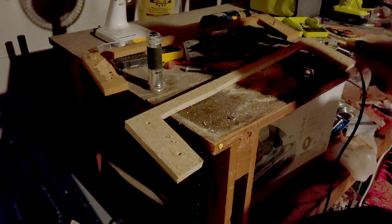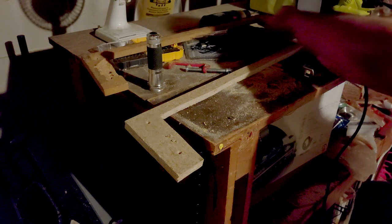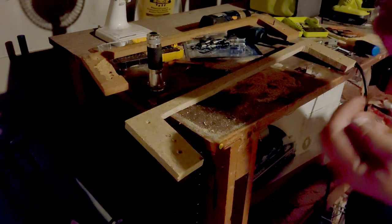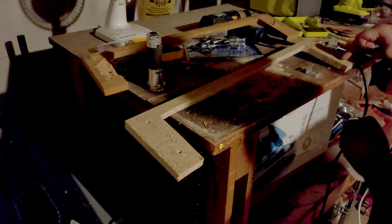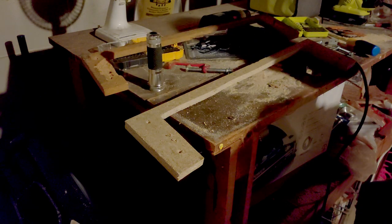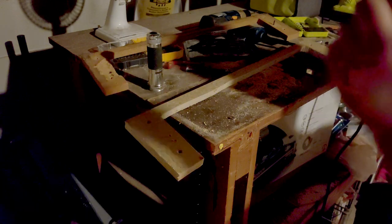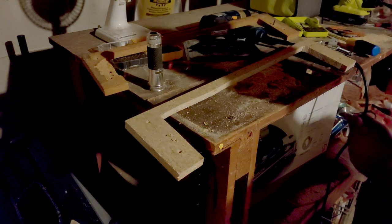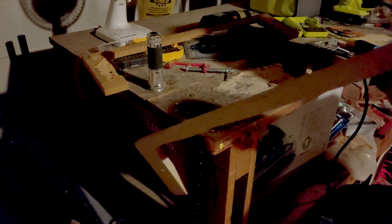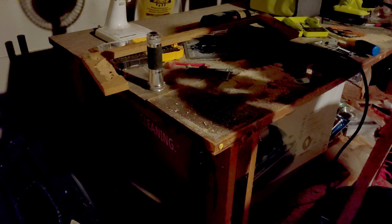fresh strike plates. So the one thing we want to make sure of is that this strike plate over here had a grounding wire that went from it to this bolt, which I think is attempting to ground the control panel. Make sure nothing ever shorts there. So I'm going to take that, reinstall that. But basically, all I'm going to do is pop my bolts through the holes.